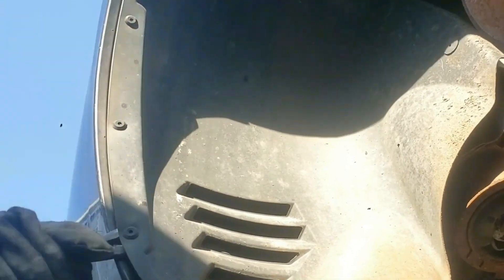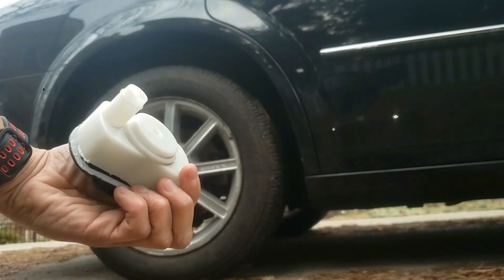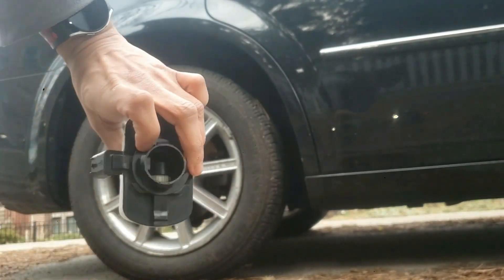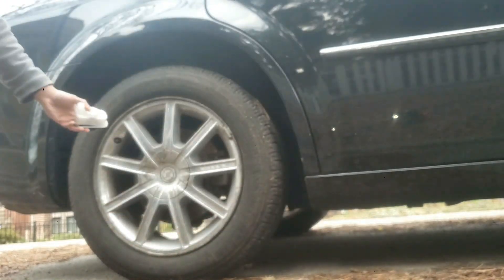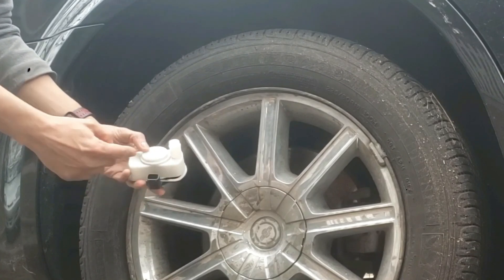It's very easy to replace this, and I have a separate video you can watch on removing and reinstalling this piece — it's in the description. Doing a smoke test can be costly and more time-consuming than just replacing this piece. By the way, a smoke test can actually overpressurize this and ruin the diaphragm and cause tears in it.